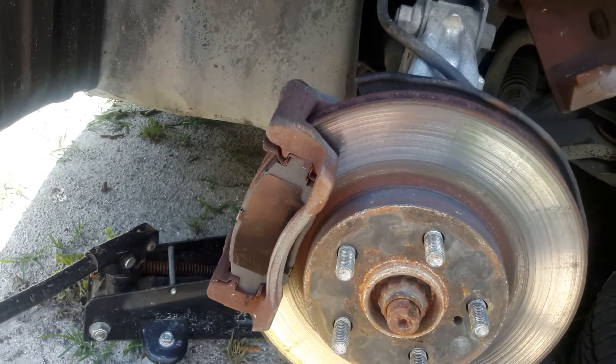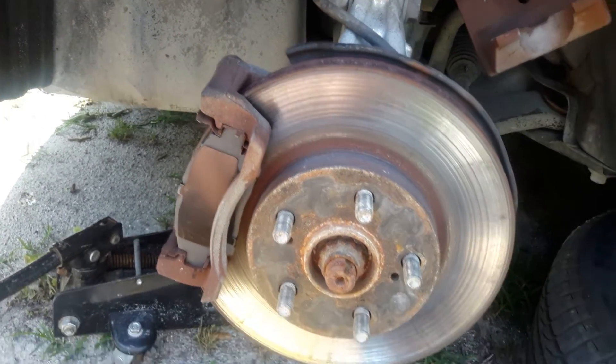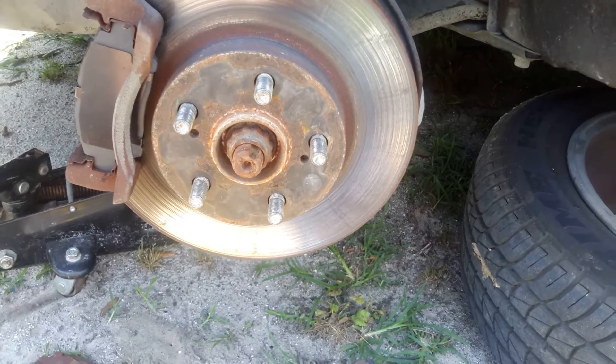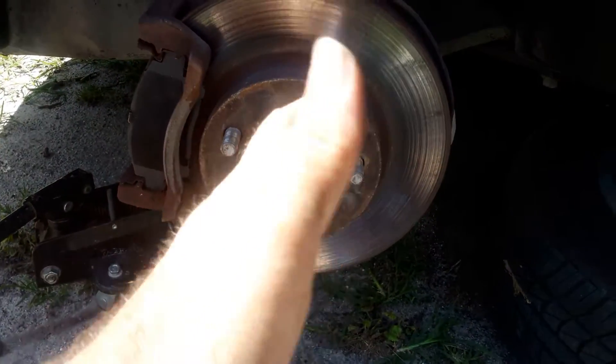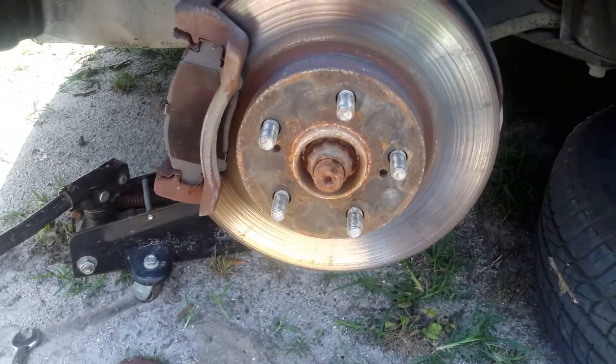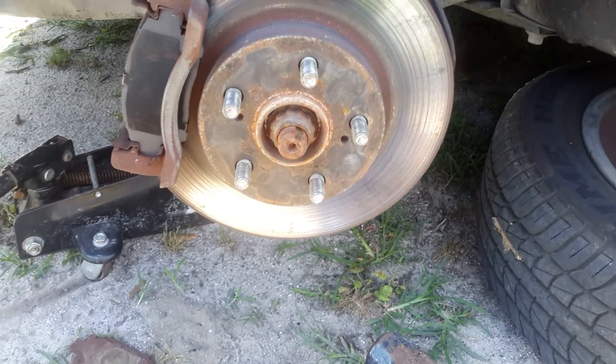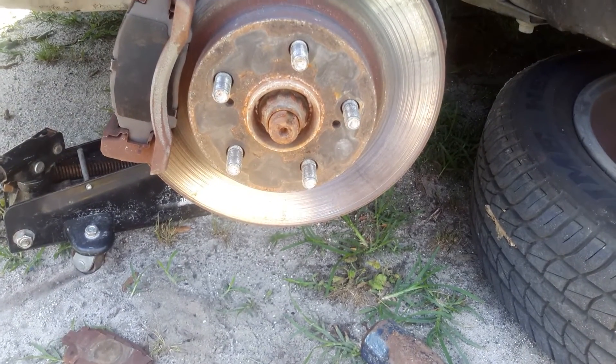Always when you're doing things, double-check your bolts. You don't want to drive down the road and you didn't tighten your bolts on your tire and the tire falls off, or it starts jumping back and forth — that'll scare the bejesus out of you. And make sure you replace that reservoir cap on top so you don't have brake fluid leaking everywhere and have impurities coming in.